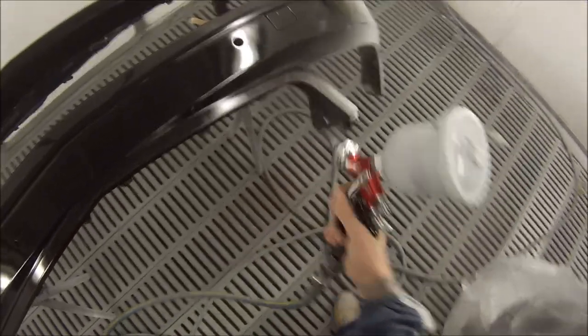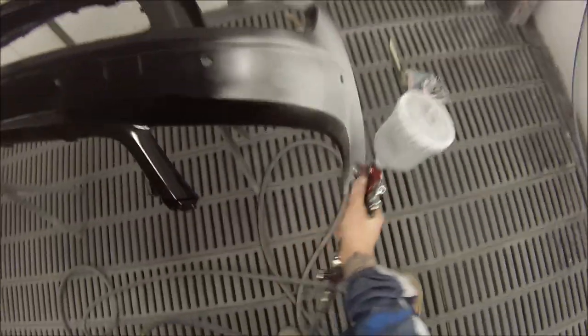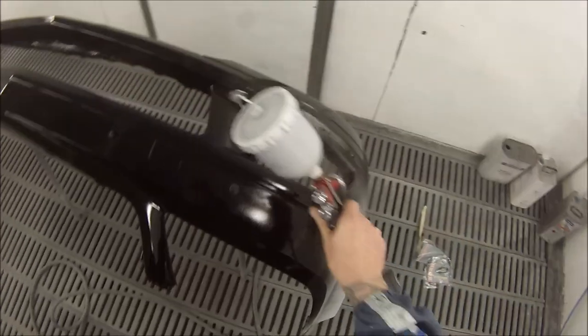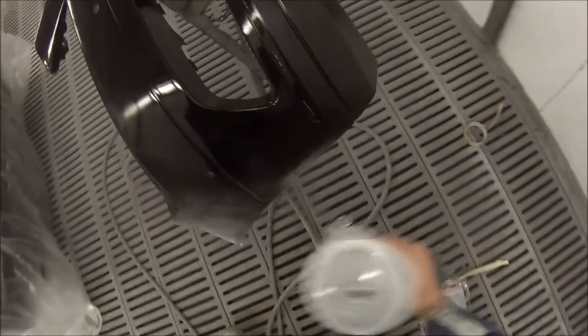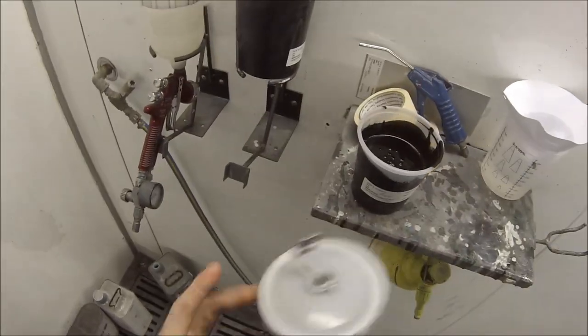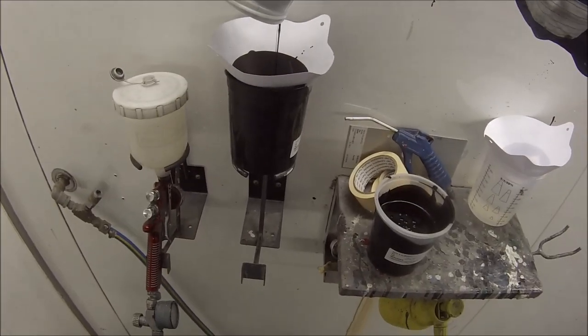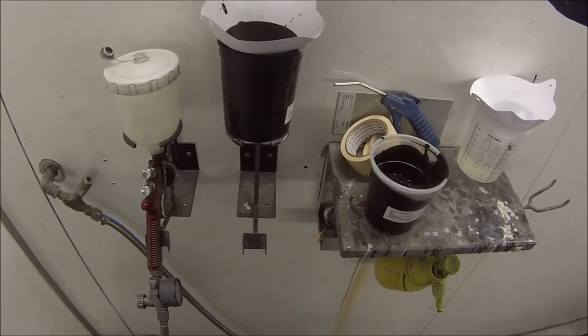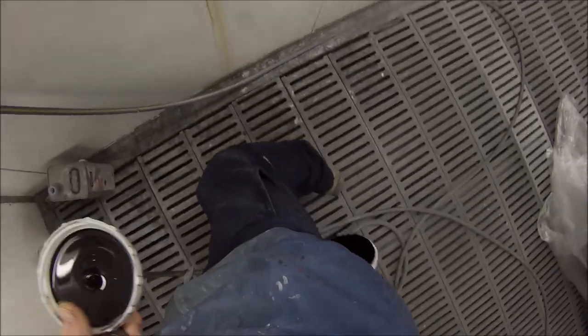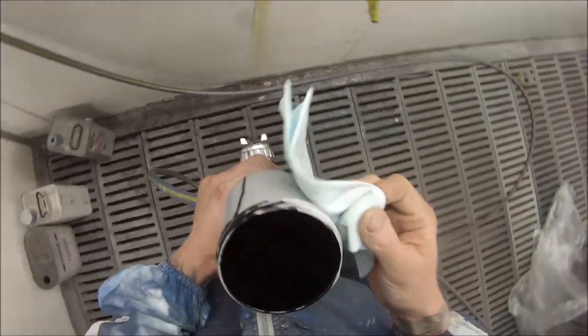There are a few issues we have over here in Australia because this Standox in Australia is actually made in Australia. The blacks are good quality paint, but the colour matching on some of these blacks isn't really that good — they've improved it recently, and also the dark blues. Any colour that has 855 as the tinter number — just put half of it in, then you can add more if needed later on.